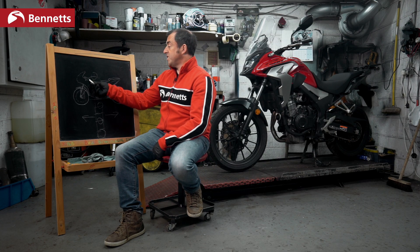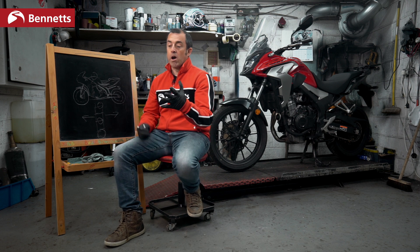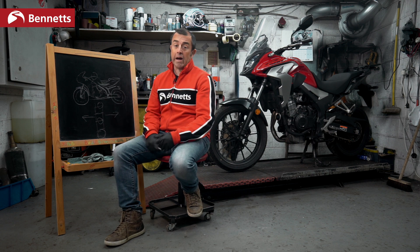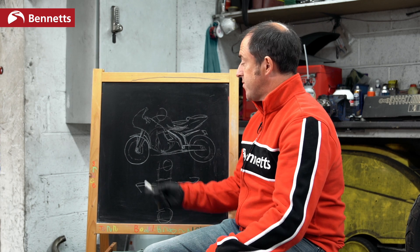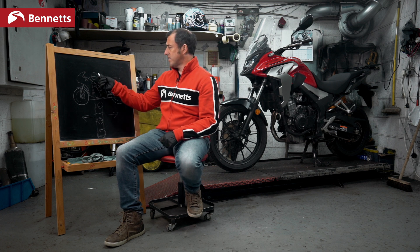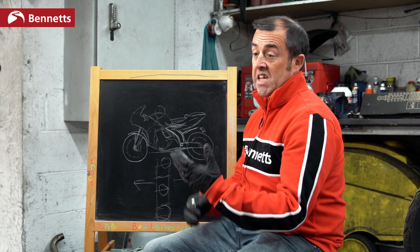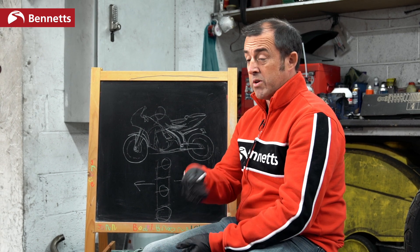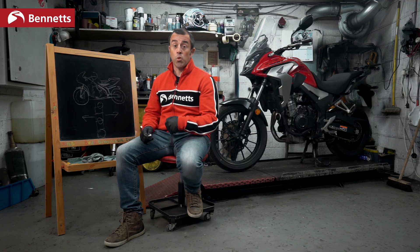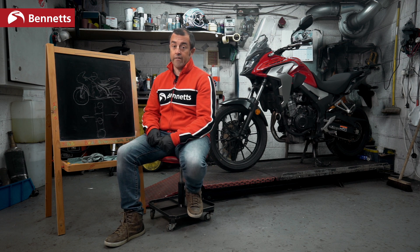On a conventional road bike, the fuel tank holds around 17 litres, which works out to around 17 kilograms — about the weight of a small dog. On a race bike that can be 20 or 24 litres; on a TT bike it'll be 24 litres — now we're getting to a sizable Labrador basically sat on our lap. So the TT bike moves the fuel underneath the seat, the same as in BSB, World Supers, and MotoGP — the fuel becomes a lot lower. The problem with this is it increases the seat height, which is why it's not done so much on road bikes, and it's an expensive way of producing a fuel tank. But we're always looking at where to put weight and where to move it.